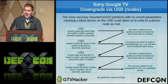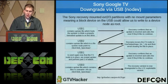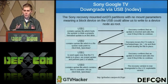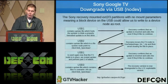That's what we wanted. It then, instead of rebooting or deleting the files, would drop us back to the main menu. From the main menu, we repeat the process, insert USB 1, which would get us past that first prompt, and then we'd swap it out with USB 3, which contained our image of the flash file system. When we hit OK, it copied our new modified image with an exploitable recovery of the flash file system right over to the block device. And doing that, we were able to rewrite the internal flash only using software, which was great.